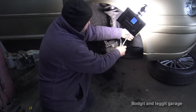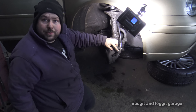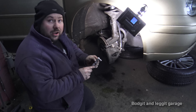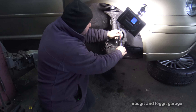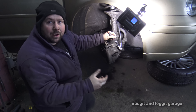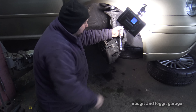So that should hopefully do it. You can leave this open for a few minutes and let the fluid drip out just from gravity — that will bleed it about 60 percent of the way. But because we've got John here, I'm going to get him to pump the pedal. When the pedal is hard, I'll release the bleed nipple; he keeps pressure on the pedal so it goes all the way down and the fluid comes out. Do this two or three times until the air bubbles stop coming out and then it's bled.